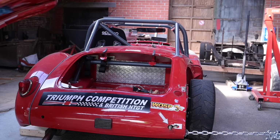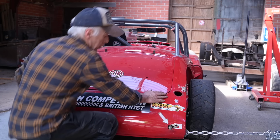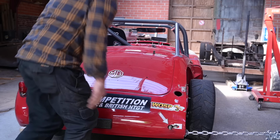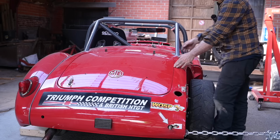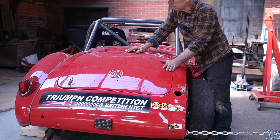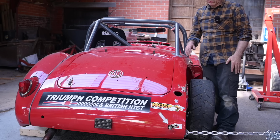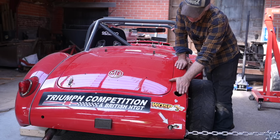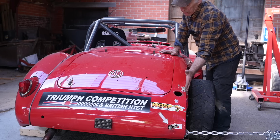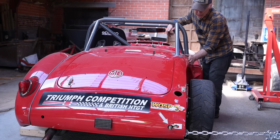Let's see if we put the bonnet on, if we still have this big gap in the corner. And this is where you used to have a gap, which was this high up. Now it is as good as flush, especially if we go in to lift it up a bit in the back here. So I think this will be quite all right the way it is. All right, so that's good, or reasonably good. Next up will be filling up all the dents and sanding it down. Most of the dents are out of it, but before I do so, I want to make sure that the fender is fitting, because I'm not sure on this side here. We might have to push a bit over here, because I think this is way too far in.